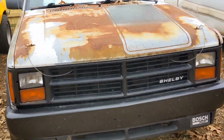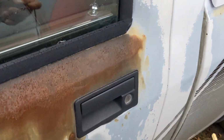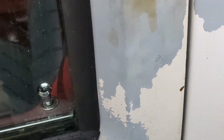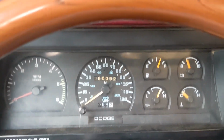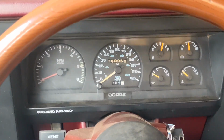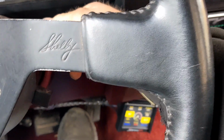It's been a little while, but I finally got the ignition parts in for the Shelby. New wires, the spark plug boots, and you can see the new plugs there that I've already had. So I'm betting that there's probably a plug that has missing porcelain, or a strap burnt off or something, because it runs weird.